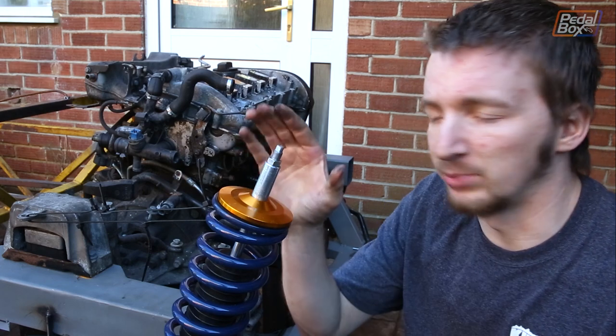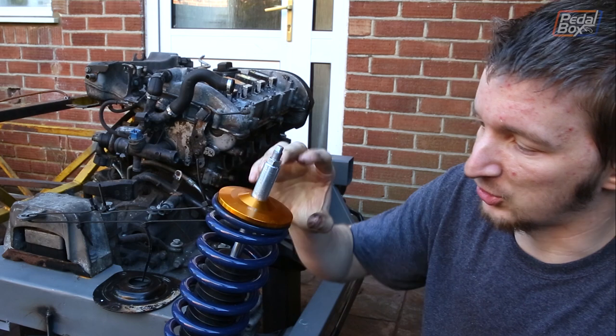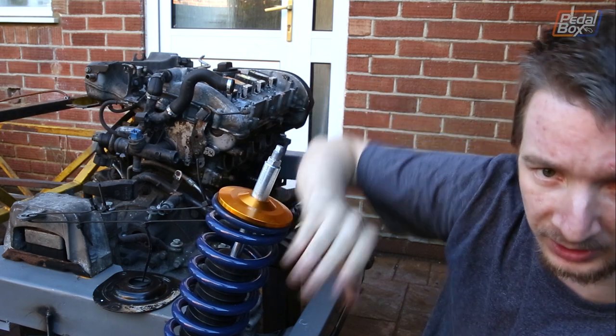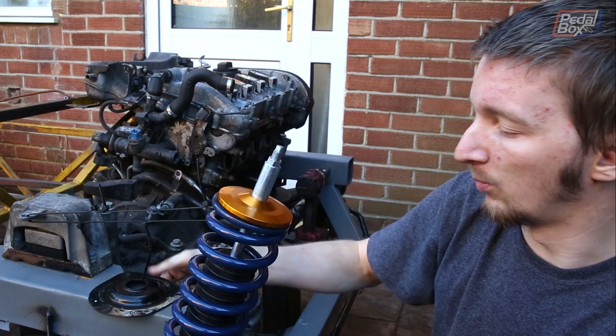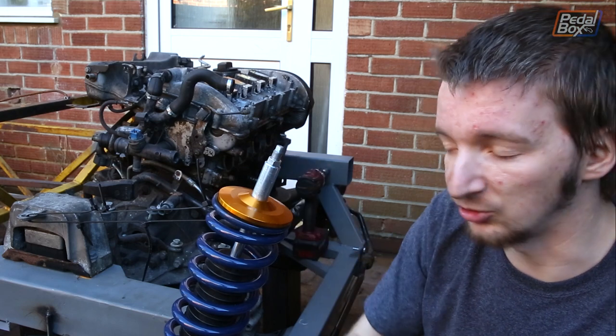What we're really aiming to do is simplify the suspension a little bit. The coilover as built for a Golf does a bunch of jobs on this one little thread at the top — one nut keeps the bushing in contact with the top hat that holds the spring compressed, then another set of parts holds it onto the body. We're trying to simplify that by taking some of those jobs away from this thread, which will make it a lot easier to take on and off the car.